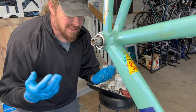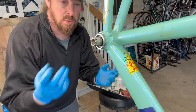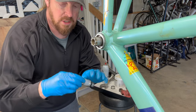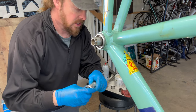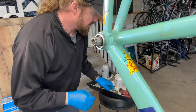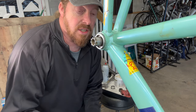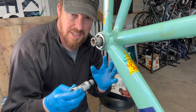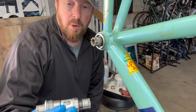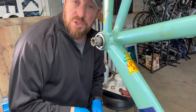They came in several different sizes. Road bike bottom bracket shells are usually a 68. 72 or 73 is like the mountain bike sizing. This one is a 68 and a 109.5, which is for the 105 or Ultegra cranksets. That's where you're looking at the measurements: 68 shell, spindle length, and also thread pitch.